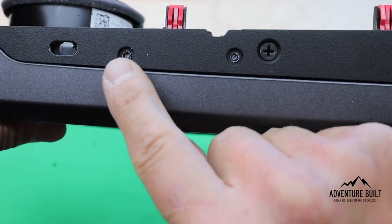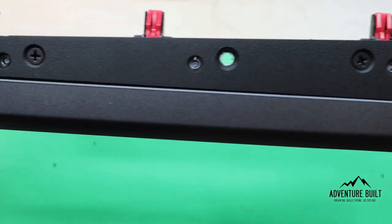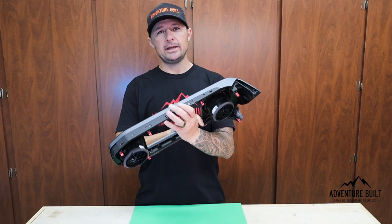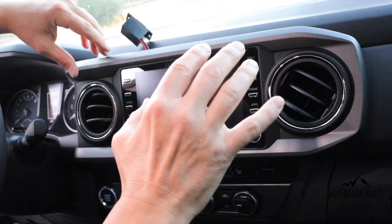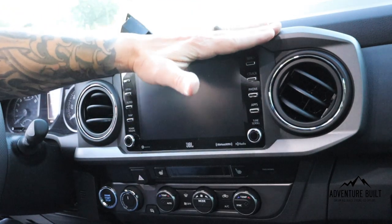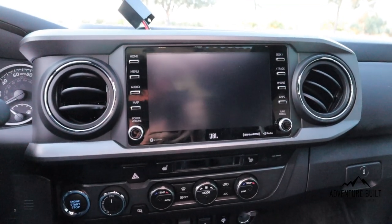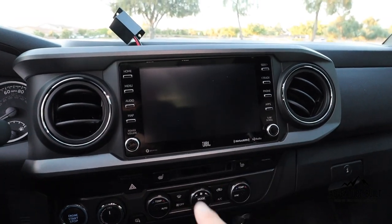With the second and fourth screws tight and secure, check all your holes to make sure they line up the way you want — mine were a little off and needed some adjusting, but now they're spot on. We've got the base plate mounted to the bezel. Taking it to the truck to fit it in and confirm the drilled holes align with the brackets already on the head unit. I had minor difficulty getting the bezel on — it was catching at the top — so I put the top edge in first, got the tabs into the holes, then rolled the bezel down and it went right into place. The threads are visible on holes one and five. It lined up perfectly.